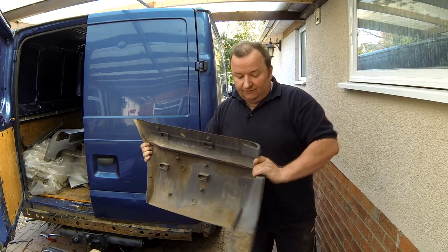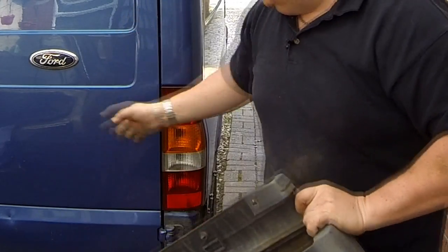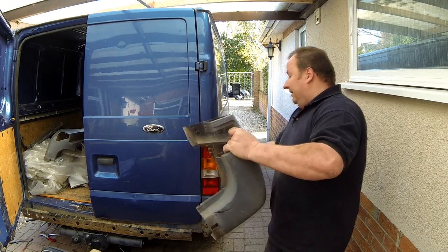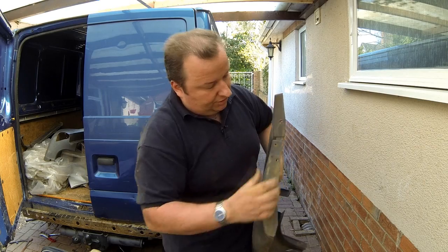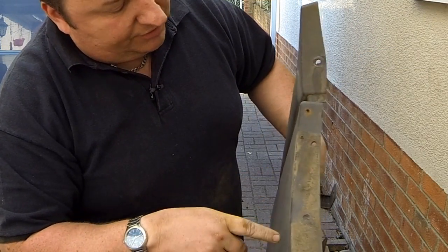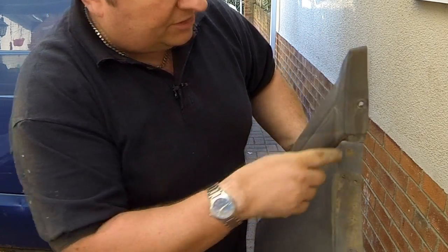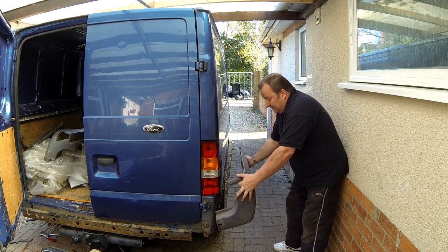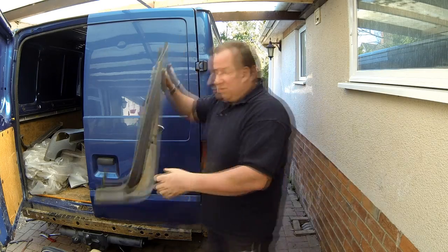On the inside of the door you've got one there and one there — I broke the heads off them, and they're literally just inside the door there and lower down. And likewise on the wheel arch side you've got one, two, three — two that hold the main bumper on, and it looks like I had a mud flap on here as well, and just one holding that top bit. So once you pop them out, you literally pull the bumper cover off — and that's what you've got.